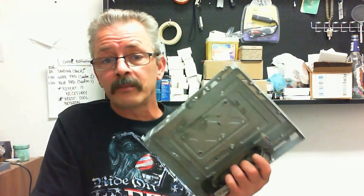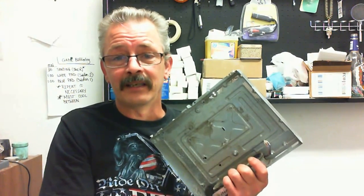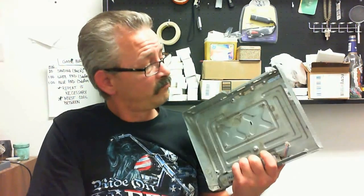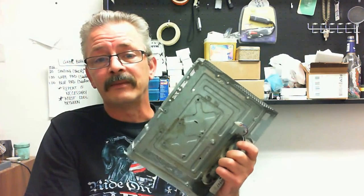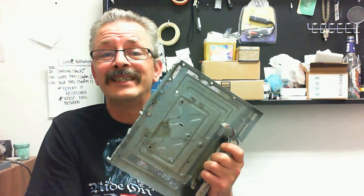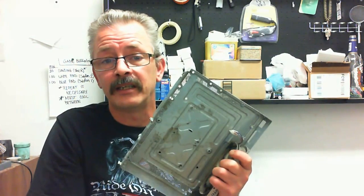Now, use a heat gun on the motherboard, I guarantee you, even if you got them exactly right and you got your reflow exactly right, you've damaged the solder beneath all the other chips, which is why you wind up with south bridge issues and ANA solder issues and stuff like that. 99% of every single red light issue these boxes get is going to deal directly, especially first time, with the GPU and or the CPU chips only. Unless somebody's gotten in there and did a heat gun trick.